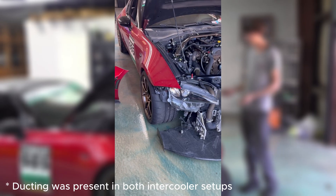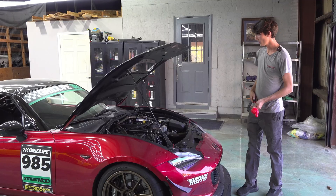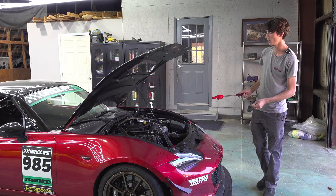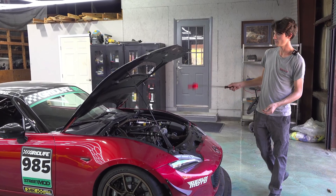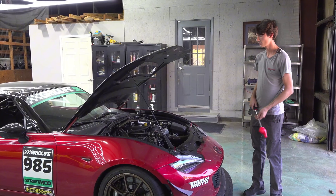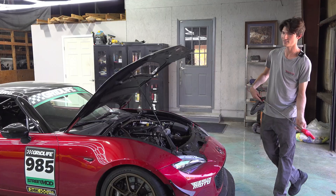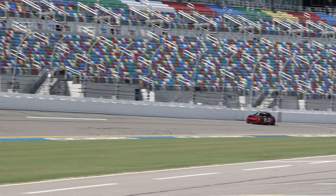Our setup making 440 horsepower is on full E85, so we run the XDI high-pressure fuel pump and 2000cc injectors, which has been really wonderful. We actually have their 60 pump, which is why we can run up to 500 horsepower on ethanol with these.